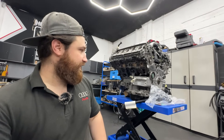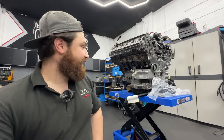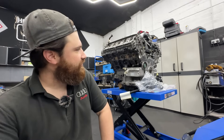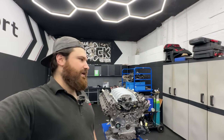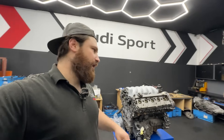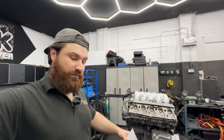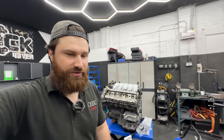Next up I have to put it on a pallet, strap the engine down, and create a cradle around it. I'll put all the gaskets, PCV valve and whatever's left that needs to go on the car, somewhere in the box, and keep you updated on how it goes in America. I wish Philip all the best with the engine and happy miles. He needs to run the engine in - I've put a new oil filter in there and advised him to do a couple hundred miles, take the oil filter out, drain the oil, check for any debris, and put fresh oil in. Just to make sure whatever we've been cleaning, and whatever dust is still in the engine, doesn't damage it for a long time.